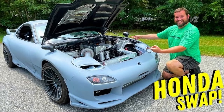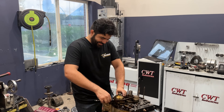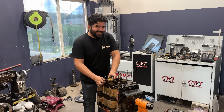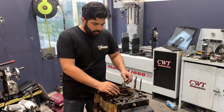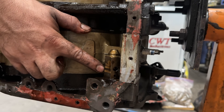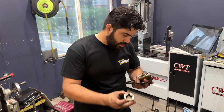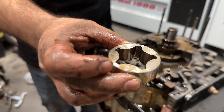For those that have been keeping track, this is the engine that came in the now K-swap FD that I bought from Orlando, Florida. The car was kind of a mess, but I was told that this was a roughly 5,000-mile reman engine. And obviously we have question marks about that — it definitely got a good 20 years on it looking at it. So this might be the original engine. The old pump will tell us, the bearings will tell us the mileage. This old pump has some gouges on it, so we're definitely going to have to replace that.